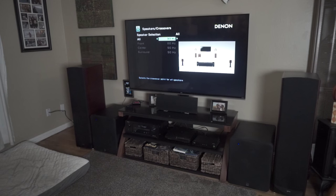Match them — if you've got one sub running, say, 55 dB and another only running 52 dB, you want an even amount. It's not so much about getting the numbers exactly right as it is making sure they're all even. You can turn it way up to get a particular decibel reading, but it really doesn't matter as long as it's all even — that's the important part. Again, your subs aren't going to match the white noise level of your mains and surrounds.